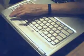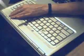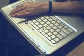At the very top of the laptop, where your power button is and stuff, that's not connected to your keyboard. So what you have to do is, on the very right side of the laptop, you'll see a little notch there. If you take a regular kitchen knife and put it into that slot and kind of bend it up, don't be scared, it's not really hard to break. Just bend it up.